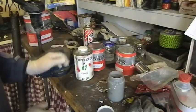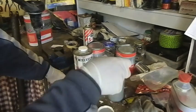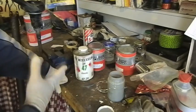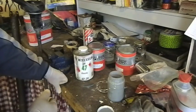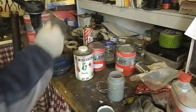This was used a lot in 1980s applications. You know, rubber spoilers, the deck lid spoilers or the boot lid spoilers that you could squeeze with your hands. It makes the paint, which is originally very, very rigid, flexible, so that with expansion and contraction on the wheel, we shouldn't get any crazing on it.